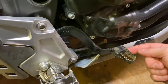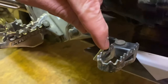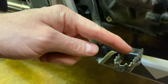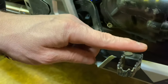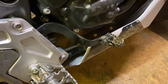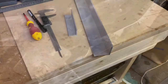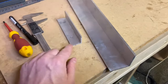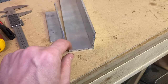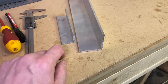First of all we will measure everything here because what I need to do is make a kind of bracket that goes through this little wedge-shaped hole you see here on the other side, that mates up into that hole. I have some L-shape aluminium extrusions which are three millimeters thick. I also have a 30 by 30 and a 50 by 50 by four millimeter extrusion, so I'll probably go with the thicker one because I have more surface area.